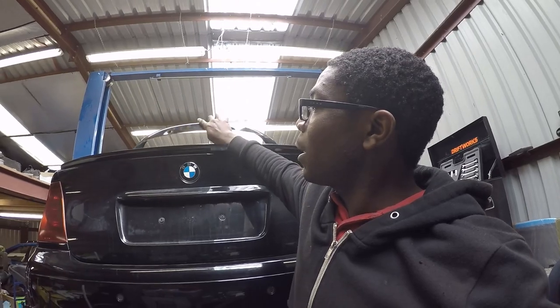So that means that I can now zero the camber, because I was running about 2-3 degrees because again of the rubbing issue. So I can set the camber, and to do that I'm going to cut the arches out and then fit these flares on the rear.